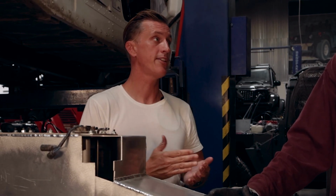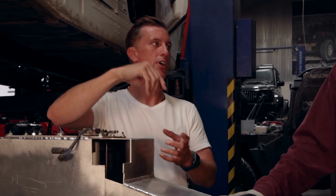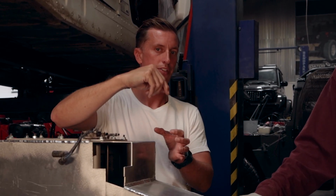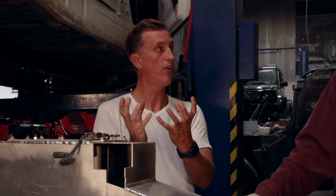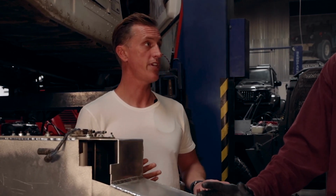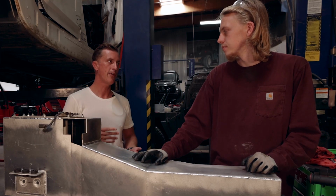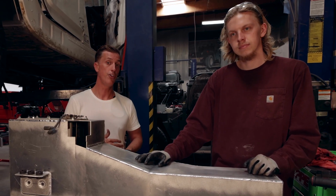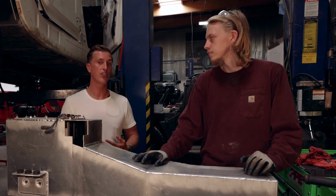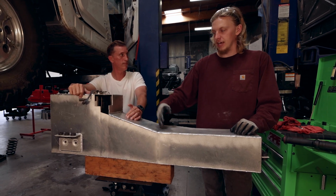And subsequently, it is a failure point on the factory fuel tank. It's actually glued in place, almost like a plastic rivet where the little prongs are melted into it. It holds that little tray in place. What happens is when that breaks free, then you have issues with starvation at lower range where you're maybe a quarter tank left and it's shutting off. It's actually starving because all the fuel has sloshed forward. So that's a normal problem on the H1 Hummer. We're seeing it now as a common failure point because these trucks are 20 plus years old.